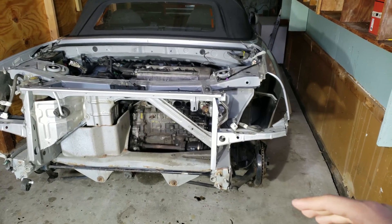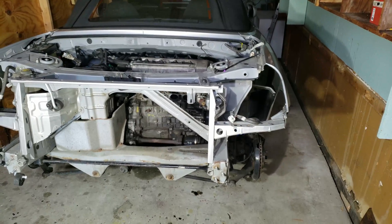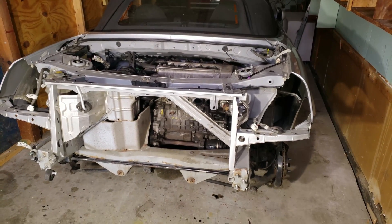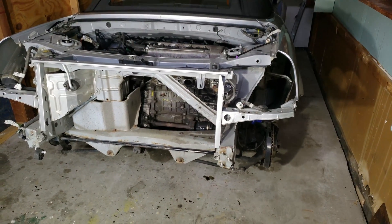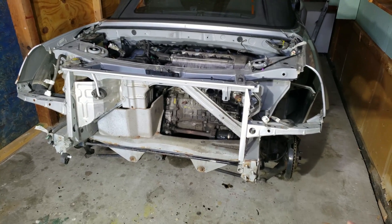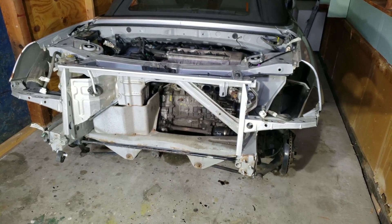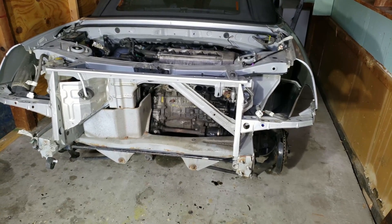The second effect is about how much load the car is pressing down on the tire. Tires have something called tire load sensitivity — as the load changes, how hard the car presses on the tire, the amount of grip it produces changes. Now that we have a sway bar pressing down on one side and trying to lift the other, it's changing the load on the tires and therefore the amount of grip they produce.